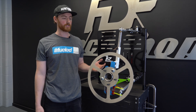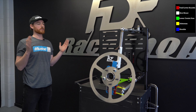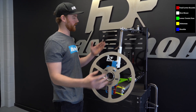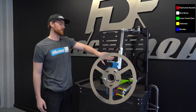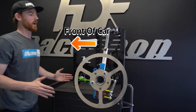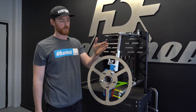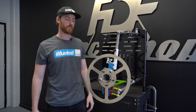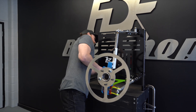With camber, it's a relatively well understood kinematic of suspension where everybody knows that, from looking at the front of the car, the camber is the angle of the wheel in relation to the vehicle's vertical axis. If we imagine this is our vehicle and this is zero degrees, we measure our wheel from the front plane — in this instance the jig is set up at around minus five to minus six degrees of camber.